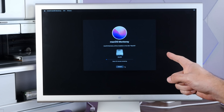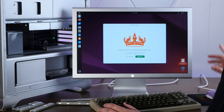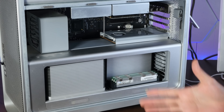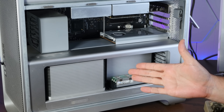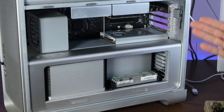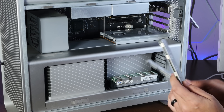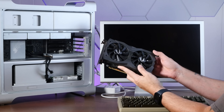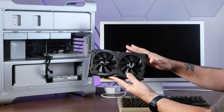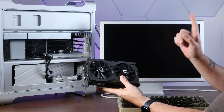Doing a fresh install of macOS to the SATA SSD, and with macOS successfully installed we can now install Ubuntu. Install complete. After some futzing around with the RAM, I've discovered the Mac Pro has triple-channel memory, and performance is greatly increased by installing matched pairs of three. I'm going to leave this at 96 gigs — 96 gigs of RAM ain't too shabby.